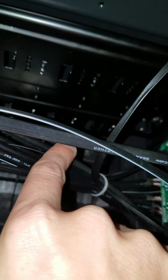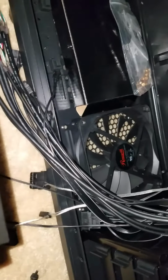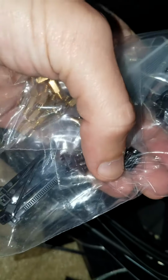But I did want to get you guys a good shot of that fan controller, and right here is where that external hard drive can plug right in. And all this is the cable, front panel wiring, switches, USB ports, all that other good junk. It's going to be a lot to hook up, but luckily, I have bought the ASUS X370 Pro, and that should provide me plenty of connections. We've gone over all of our goodie bags. That's drive screws. I'm still curious about what this thumb screw is for. Oh, that might be for screwing on the posts right here, helping to drive those in, setting my motherboard posts. I won't be able to set those until I get my board in and know exactly where to fit them.